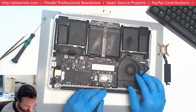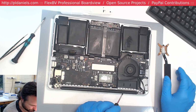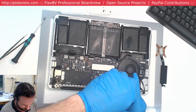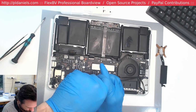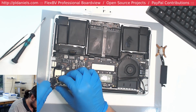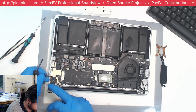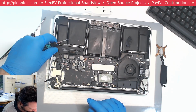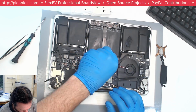Okay, so they've tried to put their shiny metal heat transfer paste onto the PCH as well, which does not work, folks. You only need to put it on the CPU part. I understand it. You sit there and you think, oh, that's exposed die, I need to put transfer paste on that as well, but you don't. Not on these ones. And it's not a manufacturing mistake when you pull it off and see that there's no transfer paste. So when you get all excited and say to your friends, look, Apple was dumb, they didn't put any transfer paste on the PCH part, it's actually you who's been dumb.